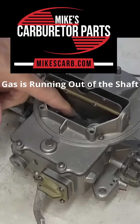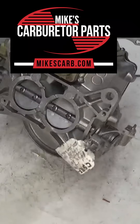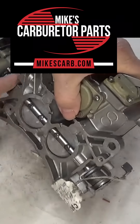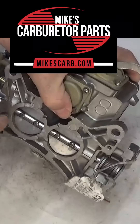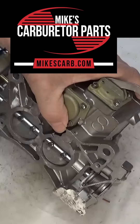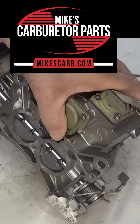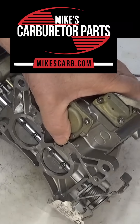What is really happening is that your carburetor is flooding, or simply getting too much gas coming down through the throat. What it does is hit these plates and run out the shaft — that's what it's doing. It's got to go somewhere, so it's going to run out of the shaft, and some of it will go into the intake manifold.